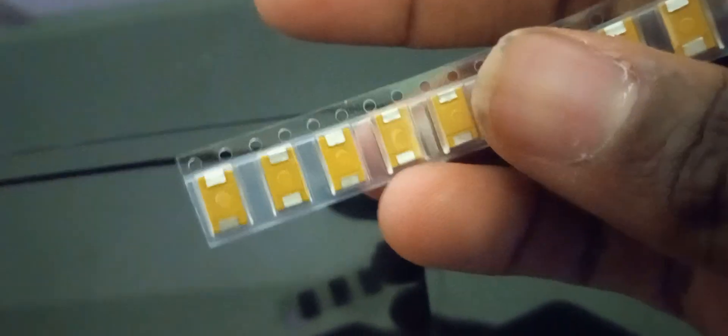The white one and the top black one have a higher chance of getting repaired compared to this one, which has a lower chance. The best way to determine and fix the issue is using a syscon to get proper diagnostics so you can track down and repair it. I'm just going to do the most common fix: replace the NEC tokin capacitors one by one with tantalum caps. If that doesn't work, they'll be unfixable. We'll focus on the white one.